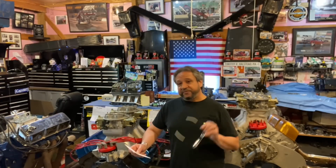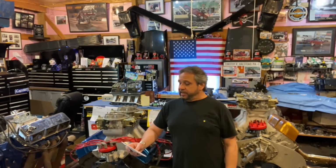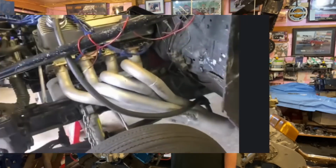So he's running 340 cubic inches of Cleveland. It's 15-to-1. His cam lobe lifts are like 488 and 498, and then you multiply that by the rocker ratio. You're looking at like 844 and 861 lift. Duration is 279 and 290 at .050, and I think it's on a 110. I don't know what he has it on. But that duration, that's like 11 degrees split.